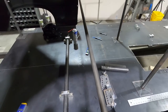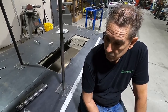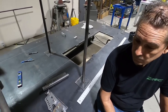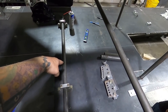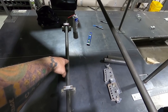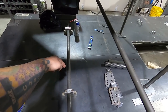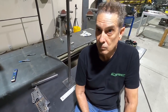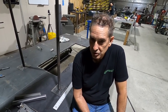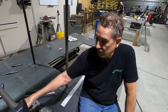He's going to go ahead and bend this cross member, then we'll lay out the frame rails, rocker bars, and floors. We'll need to figure out engine placement for where he bends the frame rails. We try to bend the frame rails so they're directly in front of the four-link brackets, because the bottom of the four-link brackets tries to push the cross member in when you let off the transbrake. Putting the frame rail directly in front of it helps with deflection on this cross member — that's where all the force goes on launches.